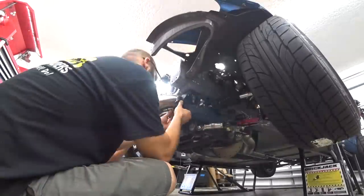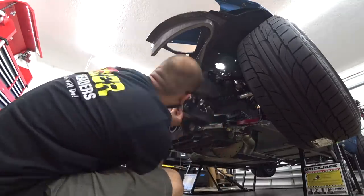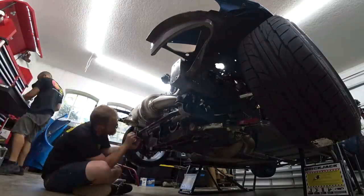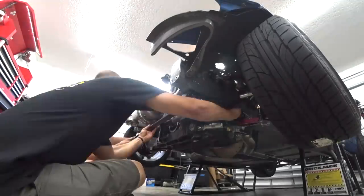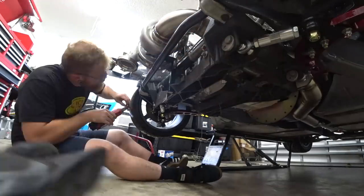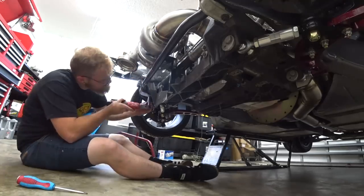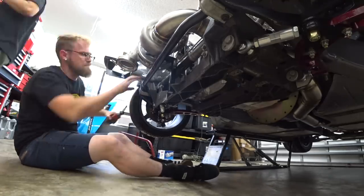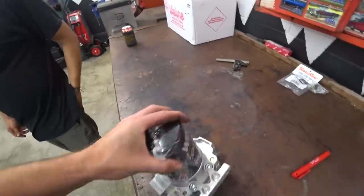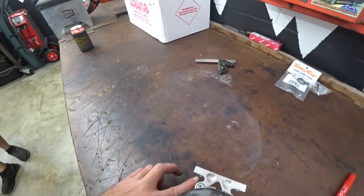While Josue handles the steam vent kit, I'm working on mounting the remote oil filter housing. We debated a lot about location — it's a big unit that needs to be serviceable. We originally considered moving it back, but decided to go with the front location near the frame rail. Before mounting, we needed to confirm the sway bar would fit with the turbo. This is the first time the sway bar is back on in a long time — and it looks like the filter housing will fit where we want it.